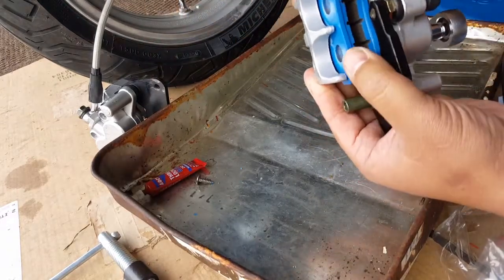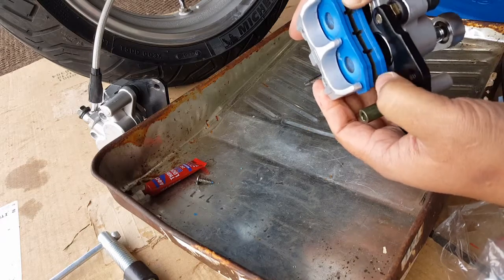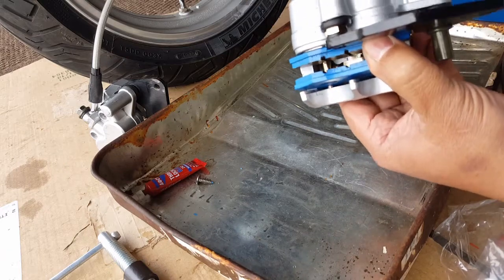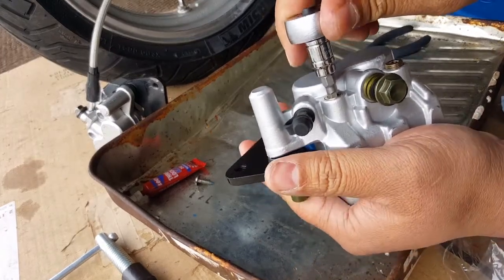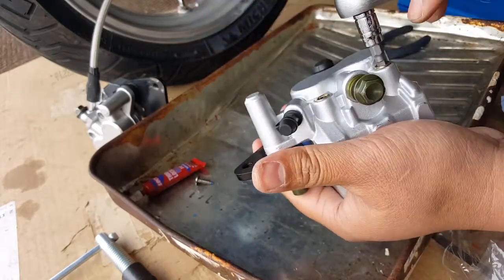Then you want to inspect it to make sure this guy goes forward. Don't worry about this guy, he's going to slide back and forth regardless. But he's supposed to be there. See, there you go. And give it a good hand tighten. Don't overdo this, just like the banjo bolt, bleeder bolt there. And you're all set. And you can mount this back onto your brake assembly. And that's how you would normally